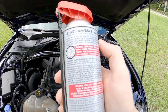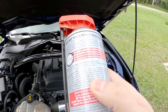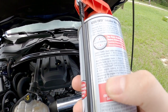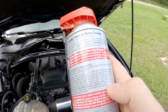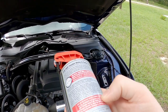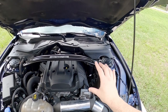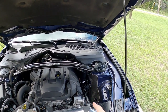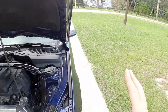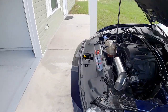The first time I used this product was with the SHO. The directions say: warm up the engine, with engine running at 2000 RPM spray product in short bursts until can is empty, accelerate the engine two or three times without exceeding 3500 RPM, run engine at idle for one minute, turn off and reassemble intake, let engine sit for one hour, restart engine and drive hard. I'm going to see if a trick I discovered accidentally with the SHO works on this car — I meant to make a video about it but never did.